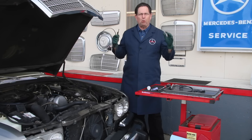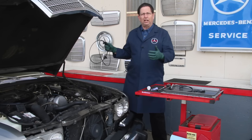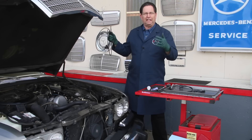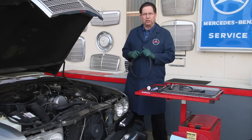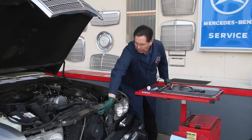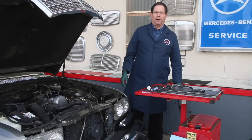We're getting more and more emails from customers saying they can't get their hood open — the engine's running and they can't shut it off, or they need to get to the oil but just can't get the hood open. Most of the time, on many of these models, you literally have to break the grill screen open to get up under this core support here to release the latch mechanism that holds the hood tight to the body.